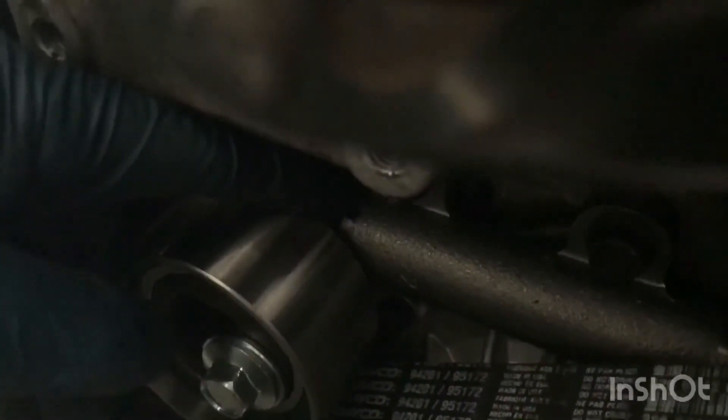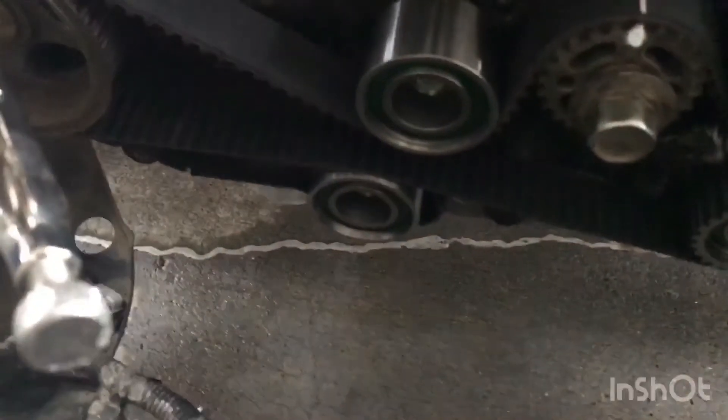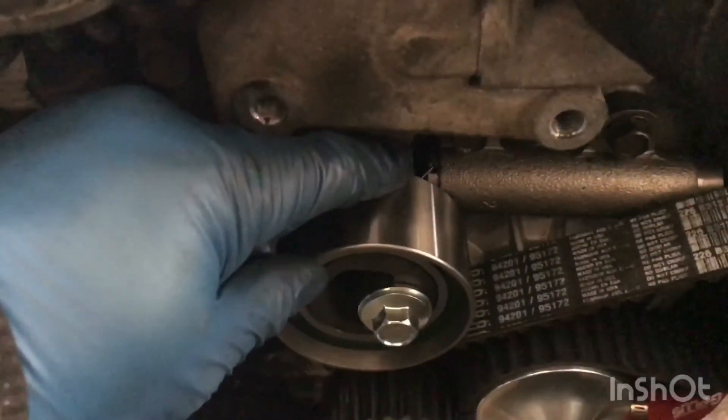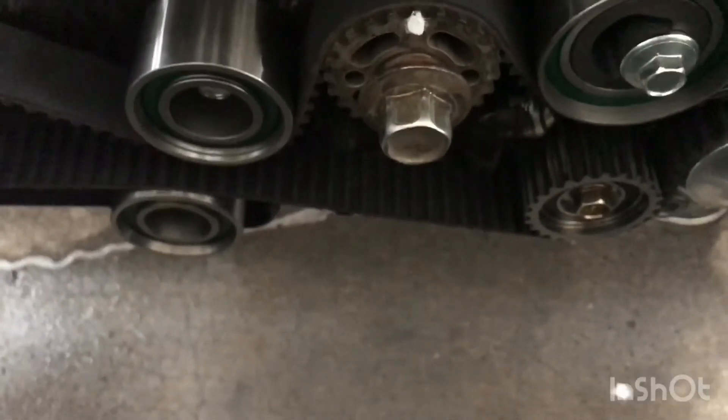There's a pin here — you want to pull that out last when you install the lower pulley. Torque the lower pulley down to 30 foot-pounds. According to AllData the spec is 32 foot-pounds, so torque accordingly. Once the bottom pulley is installed, unclamp your vice grips and then pull out the pin. Make sure everything is lined up, then grab your torque wrench and turn the motor one to three times. The timing marks won't all line up perfectly but make sure the cam sprocket markings line up with the block.